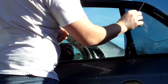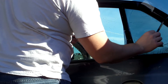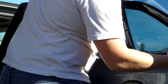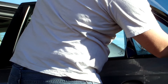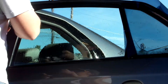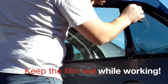Another way this helps you — especially if you've got a lot of sun and heat coming down like we have here in the Sonoran Desert — is you can take advantage of that heat to help warp and shape the tint to the actual shape of the window. Normally a flat film, like if you tried to wrap a flat piece of paper around a glass vase with a lot of curves, you're not going to get a smooth surface. The same thing happens with tint when you're wrapping it around curved glass. So you want to use heat — either a heat gun, the heat of the sun, or whatever — to help warp the tint to shape.